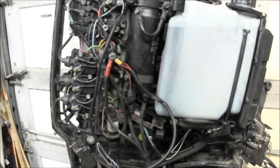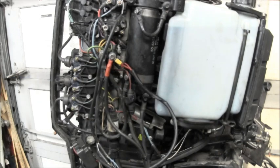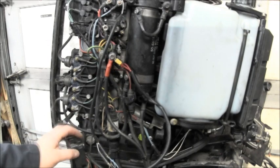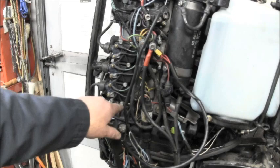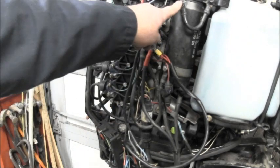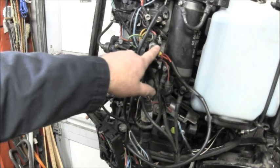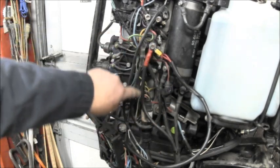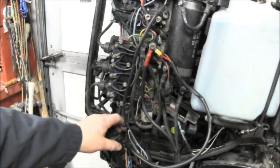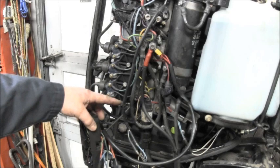So you hook up your switch, you hook up your two motor wires, and then you hook up hot. And in this case, the negative, you can see the negative, hopefully, coming out of the back of the box, it goes right to a ground. And you can ground that anywhere there's a ground. So you got your two hots going to a hot wire, in this case the wire that comes in from the battery. You've got your ground going to earth on the block.